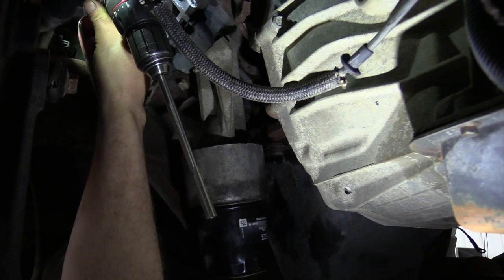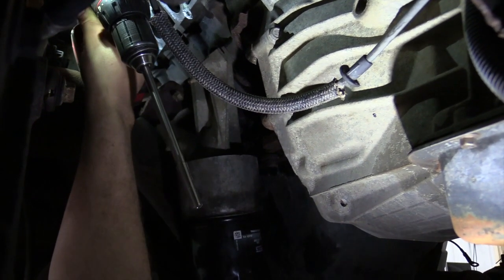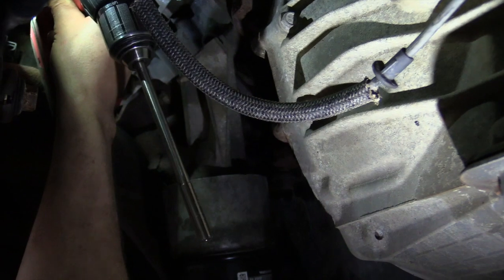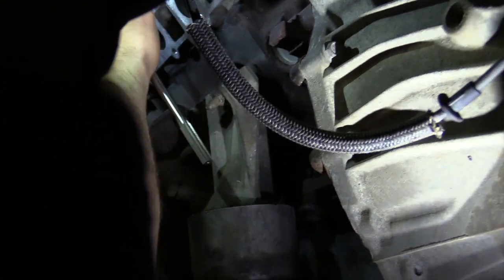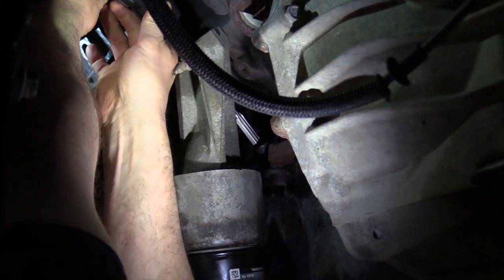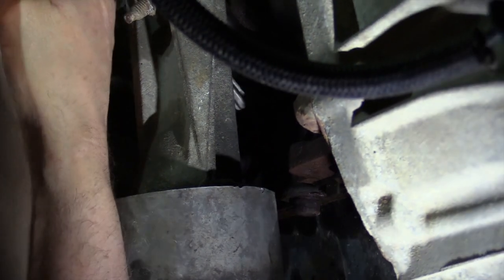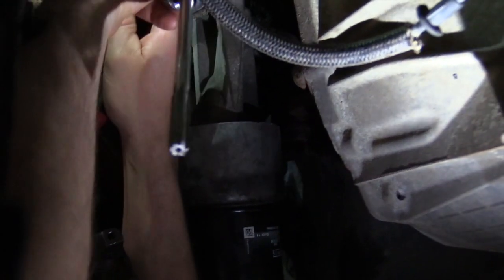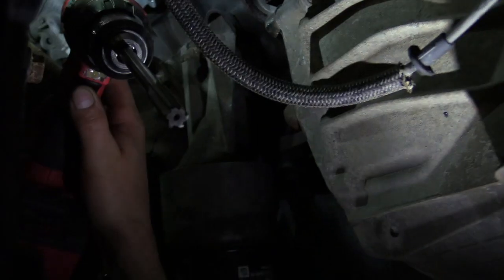There's enough flaky rust around that hole in the block where that dipstick tube goes in that it doesn't want to allow the new dipstick tube in. So what I need to do is go in and ream it. I've got a 7/16ths reamer — that 7/16ths is just about exactly what the outside of that steel tube is, and that'll clean that hole up nice and clean. There's enough room with that reamer and a drill. It's a straight flute reamer, and we can take that right down through and clean that hole up. That'll get that flaky rust out of there and allow everything to slide right in — just one more step to make everything go smooth with that new dipstick installation.